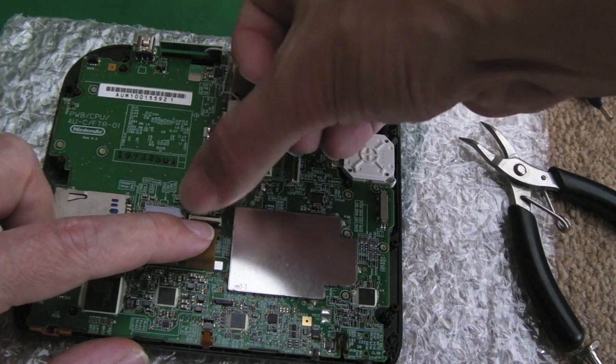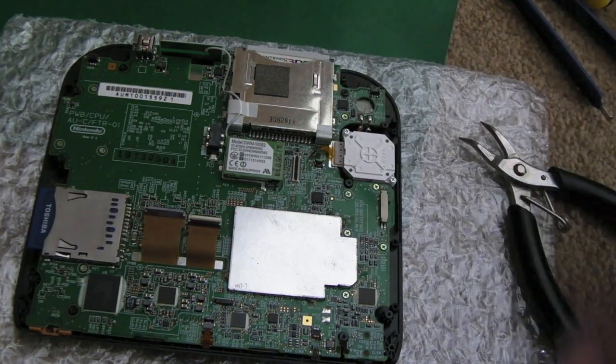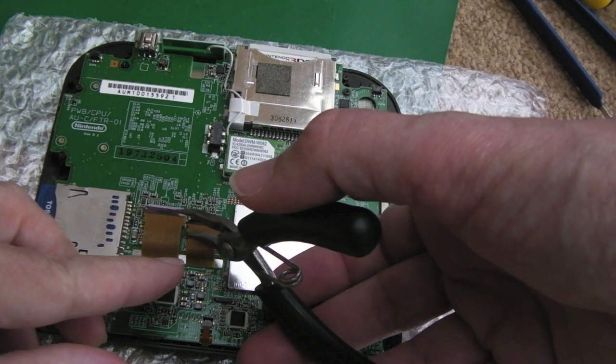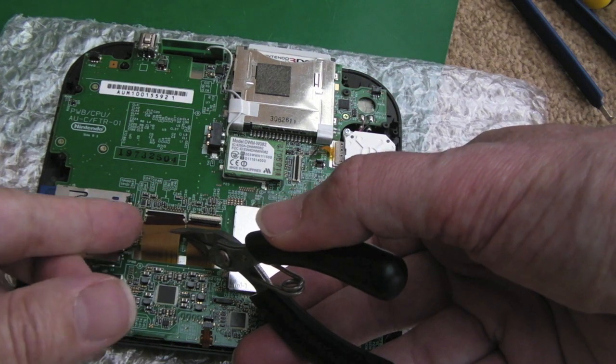Very carefully, like that. There we go. If it's not right, I may find when I power it on, we don't have video. Well, we can always just carefully take the lid back off and try and just carefully reseat these. But this is the technique. Like I say, tweezers, and be very gentle. These ribbons are super fragile. Seriously, they are. This is where things could go awry.